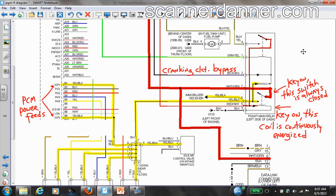A typical relay has a control side and a load side. The control side makes the magnetic field and pulls the switch closed. The load side carries current flow to our device. If you look at this PGMFI main relay, you can see two relays in here — we saw in the video that there were two relays mounted side-by-side on that circuit board. There's a coil and a load side switch for each one.